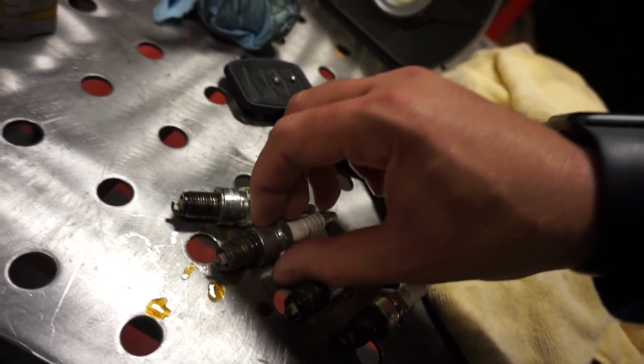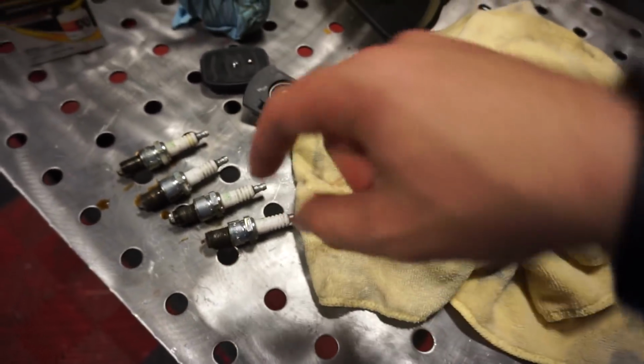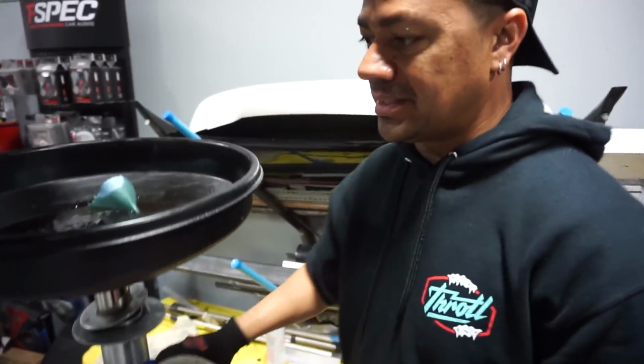So you already did the spark plugs. Come on, baby, I'm quick. Well, they don't look so bad. Full of oil, but other than that. Too full of oil, actually, quite a bit. So probably our valve cover gasket's leaking right around the spark plug area. So nothing explains the poor performance. So far, nothing, no. So we're going to have to drain completely, which is going to take a few minutes.